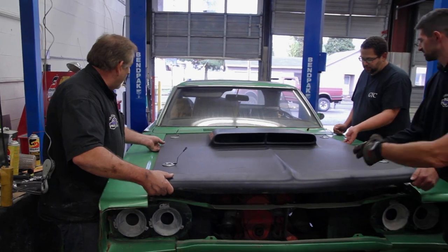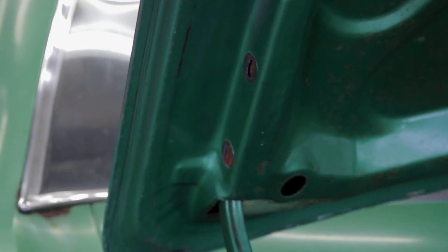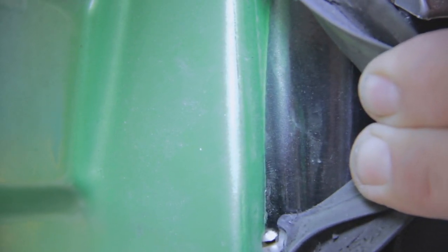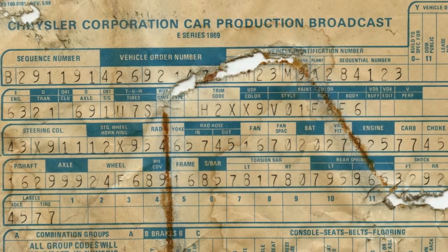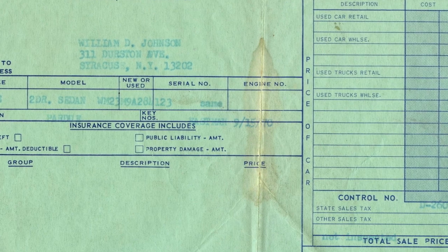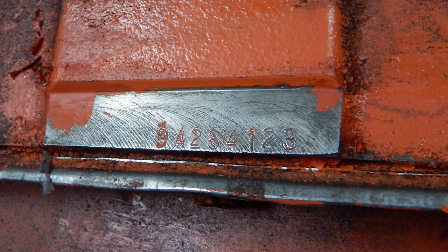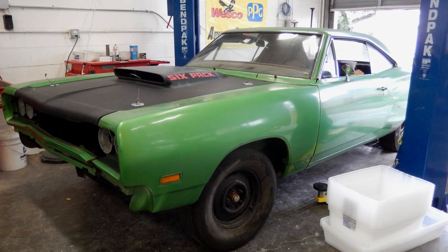We talked about the fiberglass liftoff hood. This car was an original paint car — if you look at this footage, it's all original paint, never had anything done. This is an F6 spring green color. Even though the car was wearing its original paint, I thought it was important for historical documentation to check the color support numbers, make sure they match, check for typos, and compare against the trunk lip. In this case everything matched the fender tag and the dash, which all match the title, which along with the serial numbers on the engine and transmission validate this as a pure all-numbers matching 69 and a half A12 Super Bee.